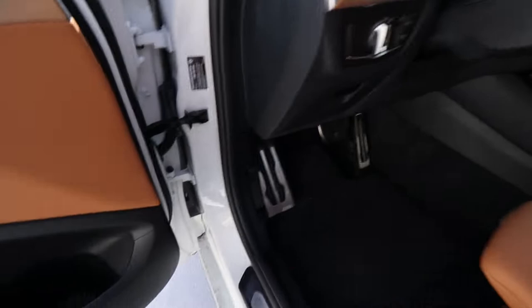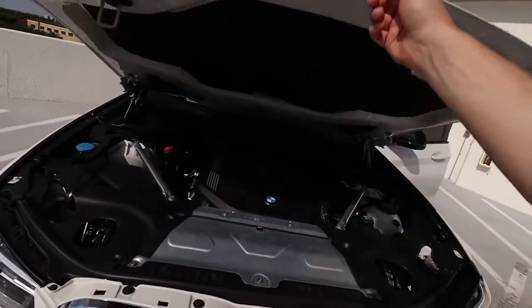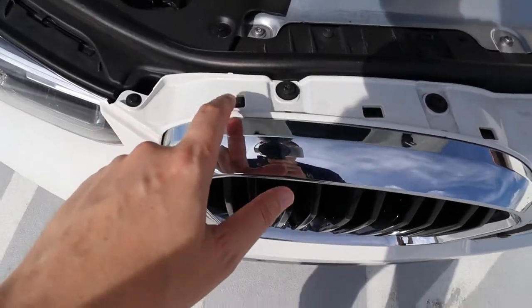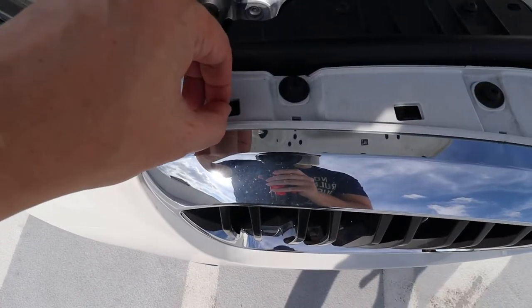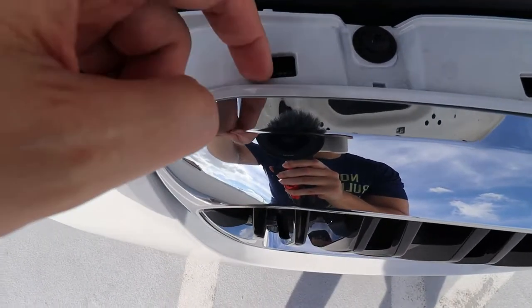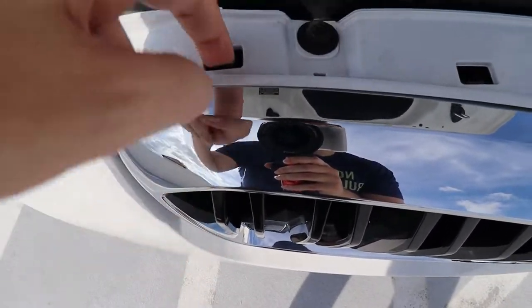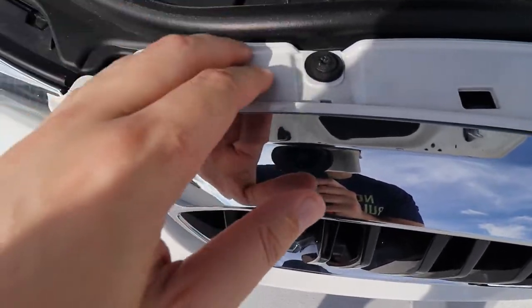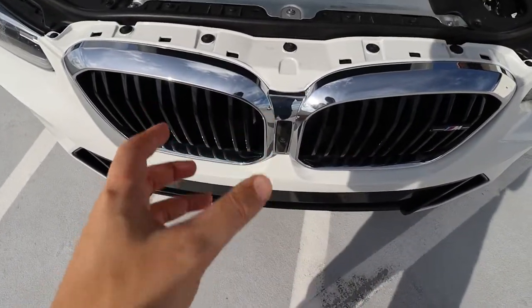The first thing you have to do — I know it's very simple — is pop this once. What this does is open your hood, but not fully. So you have to pop it twice and then you can open your hood. So let's go over what we have to do. There are these clips over here, here, here, here. What you can do is pop them, you can pry them. One way to do it is put a tool — you can do a butter knife, a plastic removal tool, a screwdriver — be very careful not to scratch something, put it in here and swing towards you, or push backwards, and this should pop all the clips. Once the top clips are removed, this should just slide out and come out. So let's see.